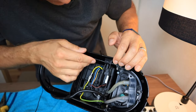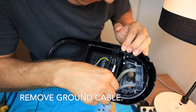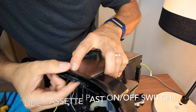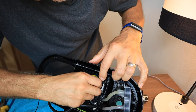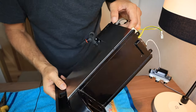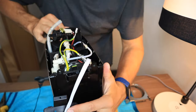When removing the cassette, there's one other thing you have to consider. You need to remove the ground cable from the bottom chassis, and you also need to sneak past this on/off switch here — that's on the side of the machine — and slide the cassette past it. That took me a few minutes to figure out. After that, you should be able to slide the cassette up gingerly out of the machine.